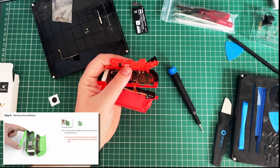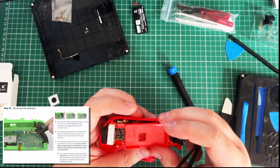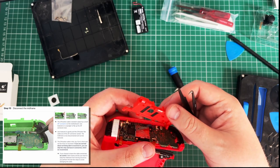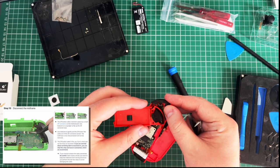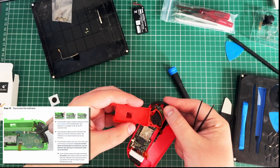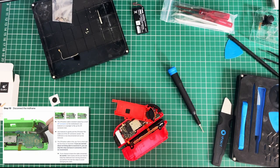Small ZIF connection on the motherboard. Use tweezers, especially with the ZIF. Okay, the ZR button cable is short and can be tricky. If you're worried about not being able to reconnect it, you can skip this step and leave it connected. Yes, I would rather leave that connected, thank you. Might make it a bit fiddlier to get to the screws, but I'd rather... Yeah, if I put it like that, I can still get to the screws in there, because that's so small, I'm not going to...